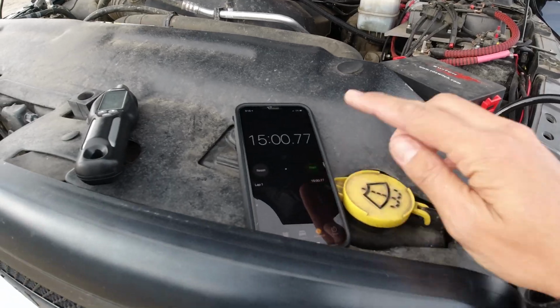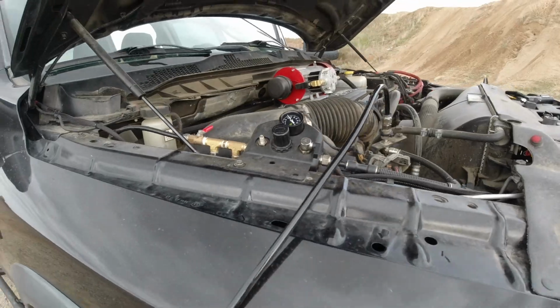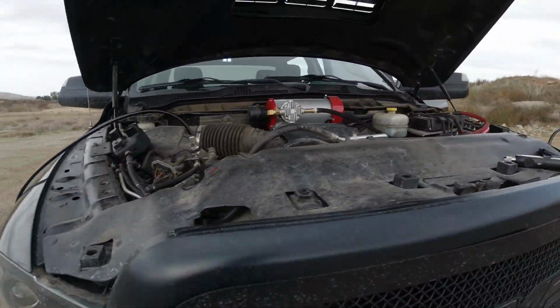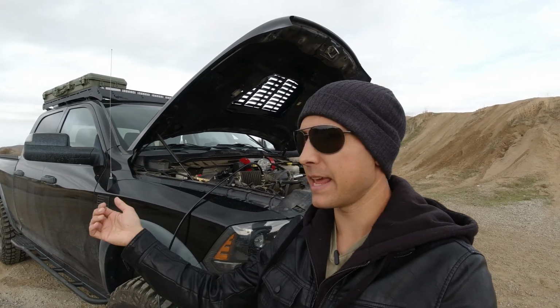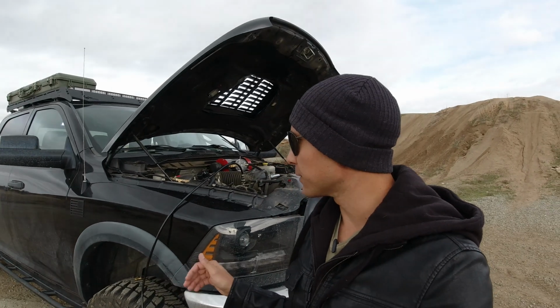All right, valve closed, and like I said, wherever the pressures are at are where they're gonna be at. Now, the other thing is, as we got past about the 13-minute mark, the compressor wasn't running very much, and that's because the air tank was already filled up, and airflow from the tank through the regulator on the UpdownAir unit is so slow that the compressor didn't need to turn on that much. So disappointing, and I don't have high hopes for my pressures being too accurate, but let's go ahead and take a look.